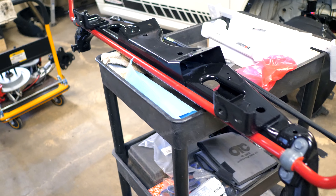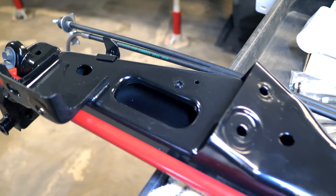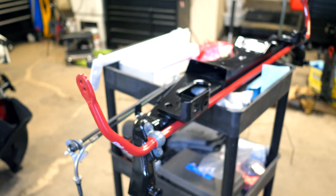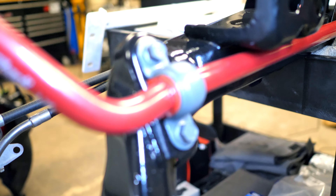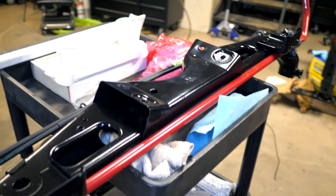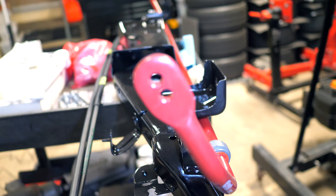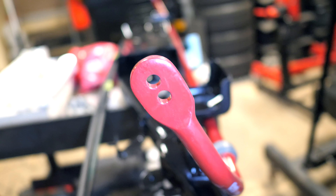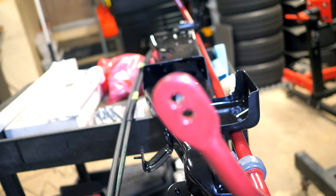Next up is the rear subframe for the Mini. I painted the entire thing and it looks a heck of a lot better than before with all the rust and corrosion. This red bar right here is an Eibach rear sway bar — you can find a link in the description box. It comes with polyurethane bushings and all the grease you need, and it's a nice upgrade over the stock stuff. The cool thing is it's adjustable — you have two different spots on the end of the sway bar where you can put the end link through, changing how stiff it is. The hole closest to the rotating assembly is the stiffer setting; the other one is the softer setting.